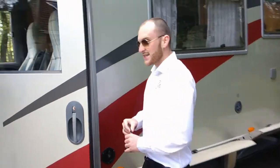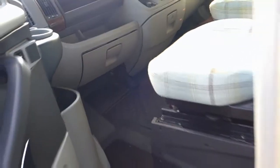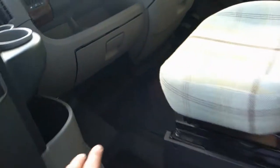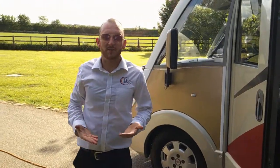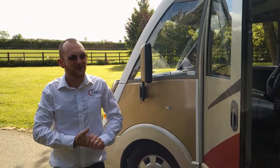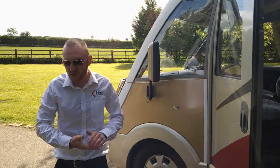The bonnet release is going to be quite difficult to show on camera. The bonnet release is actually hidden around the side here, and there's just about enough room to get your hand in. Just in front of the passenger seat there is a rectangular plastic hatch, and your engine battery is located under there. That might be considered quite inconvenient if you ever want to jump-start or charge your engine battery. So what they give you is a positive and a negative terminal under the bonnet to save you lifting all that floor up.